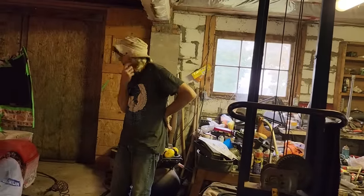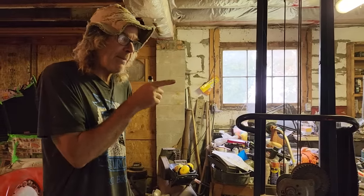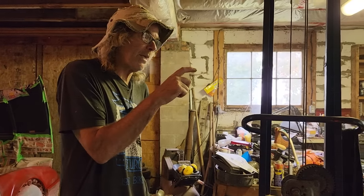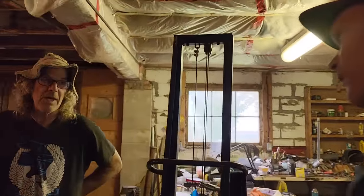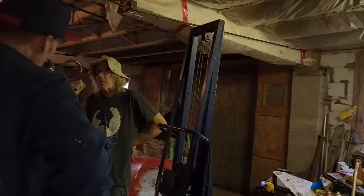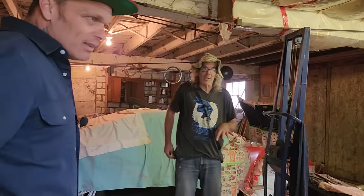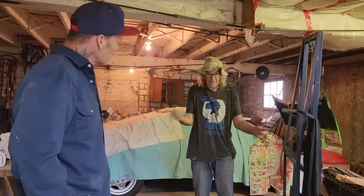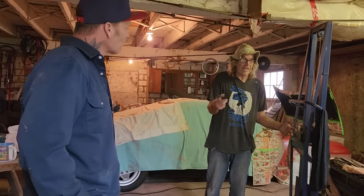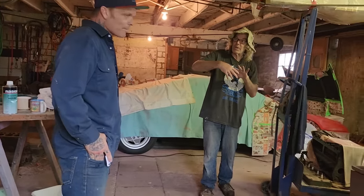I'm a waster. I'm going to have to turn the paint back a little bit. I like the pattern wide, but I need a little less paint and less air, because the paint's coming out a little faster and heavier than I want it to. I want to move a little slower and put less paint on. On the other side, I zipped as fast as I could go, and it covered the panel. But at that rate, and with the crookedness of all the different angles I have to go in around the nooks and crannies, I'm going to end up with runs from too much paint.